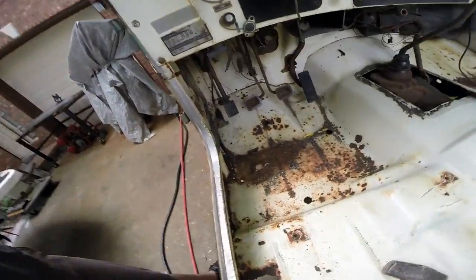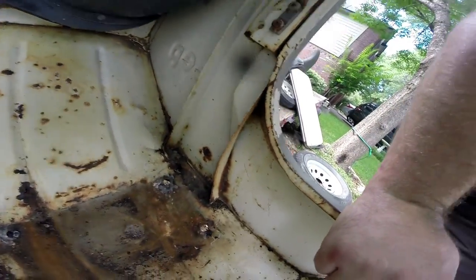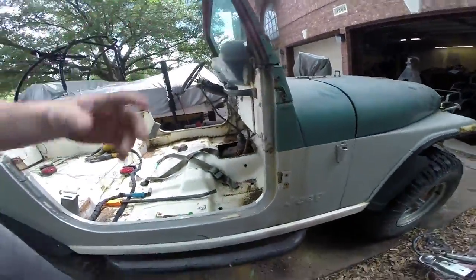To answer the question of why we do this - I couldn't see this hole before. I couldn't see all that rust damage before. Now if I bring you around to the other side, see all that right there - that cab corner - it's all rusted to shit. The way they had this done was just some washers and a nut holding it down on the backside. Kind of a janky way to do it. So we're going to cut all that out, weld in new floors where it needs to be, basically repair all the rust. And when I eventually make a full cage for this thing, we'll do a better job of welding in base plates and making it more permanent and structurally sound - tied into the frame, because this is just 18-gauge sheet metal.